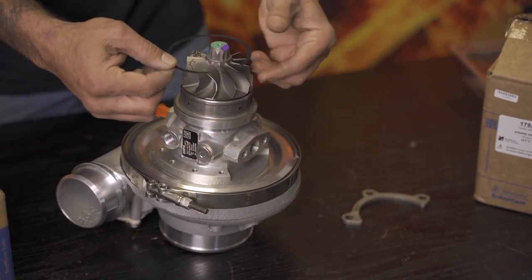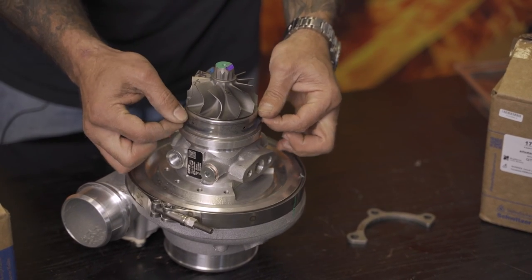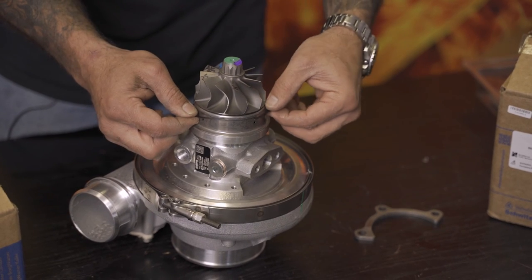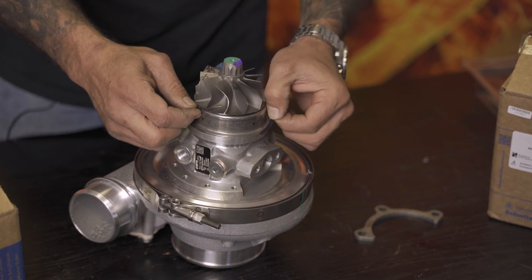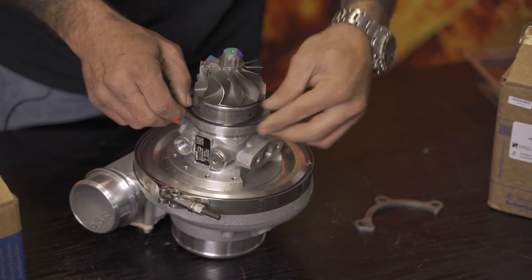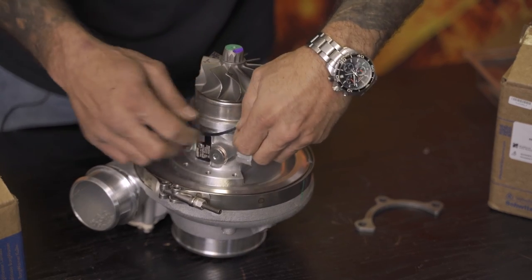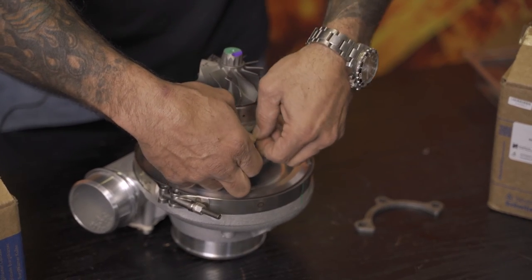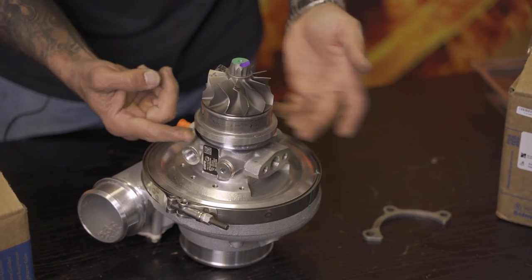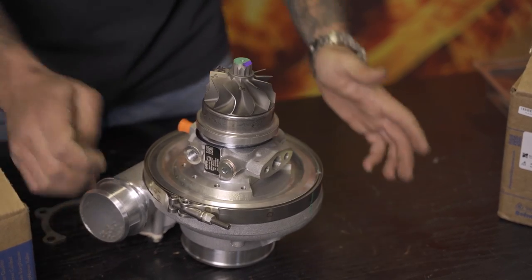As a result this preserves your clamping force on your bolts. To install it, much like a piston ring, just twist it so the load distribution ring lies against the bearing housing and the heat shield, twist it and screw it on like you would a bolt. There is your load distribution ring — try not to bend it if possible.